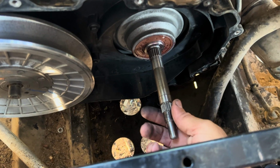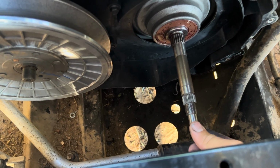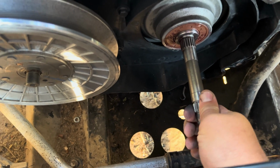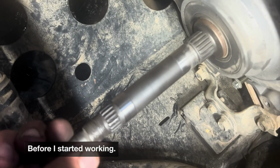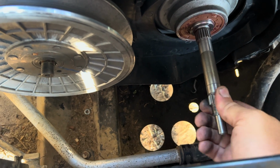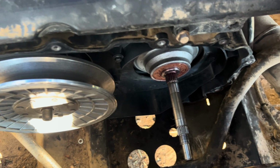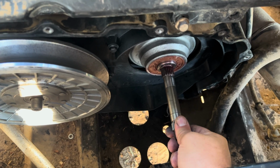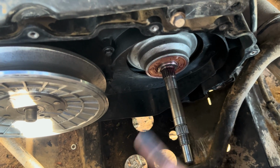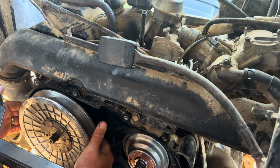So here's where my most obvious mistake is. When I had the old drum turning, I could turn it counterclockwise, and now it's turning clockwise. You would think that a one-way bearing only turns one way, and that was my assumption, but it does not. It only engages the axle in one direction. It's supposed to turn freely counterclockwise, and it's turning freely clockwise.